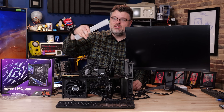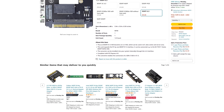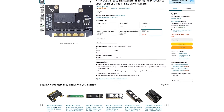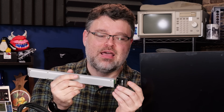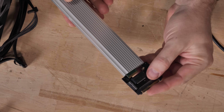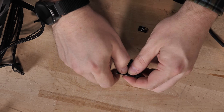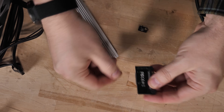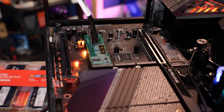The sixteen-terabyte drive doesn't work without these $20 adapters from NFHK. They work pretty well — they're technically Gen 4 compatible, but won't always work at Gen 4 speeds; it depends on your motherboard. ASRock workstation-class motherboards with a programmable redriver in the BIOS will work better. I would not recommend Gen 4 on a desktop board like this unless the adapter physically has redrivers. If you order the adapter and the card and find the standoffs are in the way — good news: those standoffs are breakaway, designed to break off. There's also a 3D-printable adapter we've put together for these cards at the Level One Tech forums.